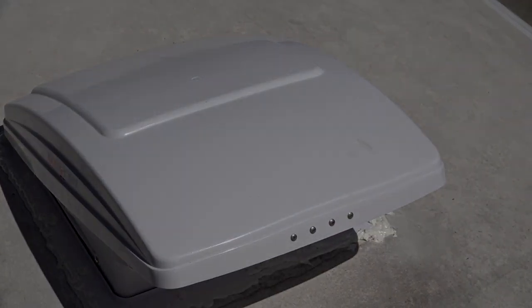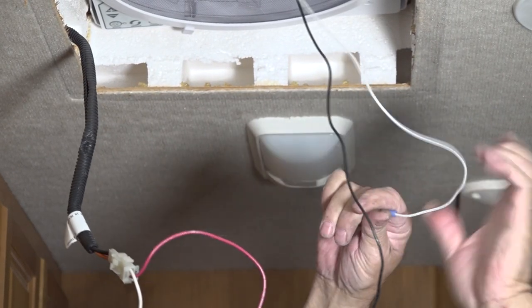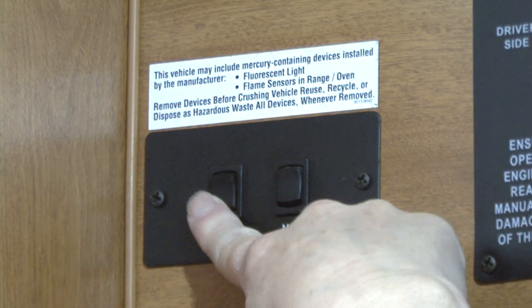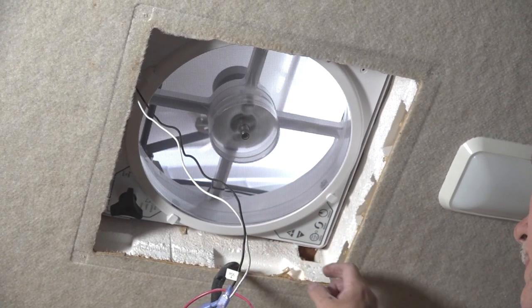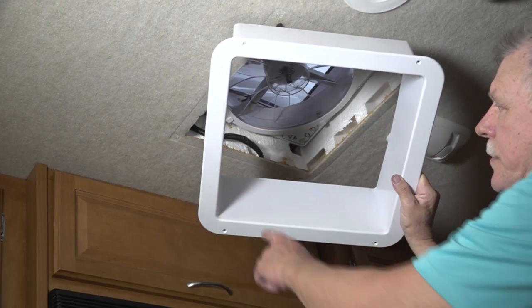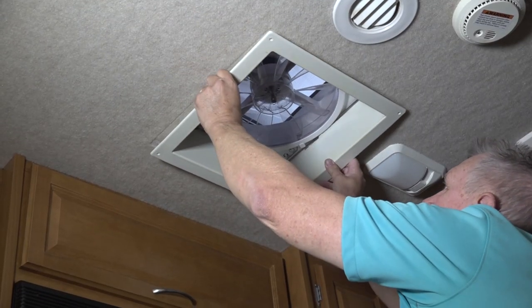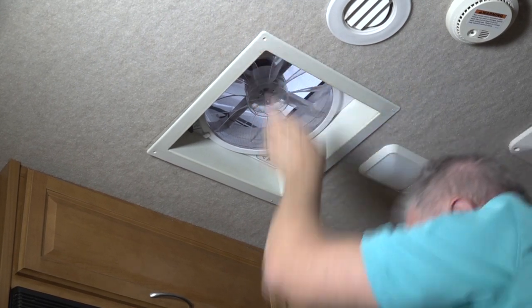Only use the screws provided. We are finished on the roof. Follow the fan installation instructions for making proper and safe electrical connections. Our fan uses a black wire for the 12 volt positive supply and white for negative. At this point you can turn the 12 volt power on or reconnect the battery and test the operation of the new fan. On a new installation you need to cut the garnish trim ring to fit the ceiling thickness; I'm using the old trim ring. Place any excess wiring to the inside of the roof opening and fasten the trim ring in place. Installing a new high powered roof vent on your RV is not that difficult and the benefits are well worth the work.